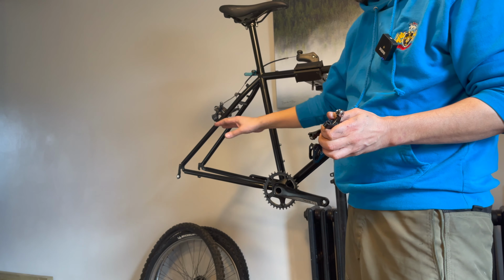When I counted it just up there, I don't know if you saw me do that, or I've put it in the video, I counted 7 and I was like, uh-oh, this could cause a problem. And that's only because I was just presuming things when I should have double checked. So it's worked out fine though. I've made this a 10-speed. We've still got this massive 46T at the back. It just means we're leaving out the last gear, the smallest gear. But yeah, running fine.